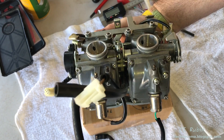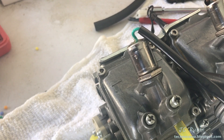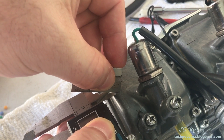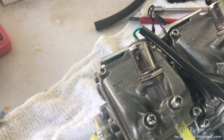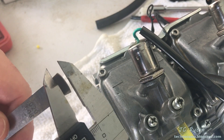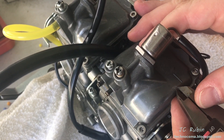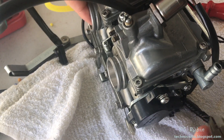We have a good seal — we can continue. To make this job easier, I'm going to pre-mark the areas on this carburetor. We know the line will have to sit between 7.5 and 8.5 millimeters. I'm going to mark those two points — you can see I already have a mark from previously; this is eight millimeters right here, the middle point. It's just a very light scratch with a razor blade. While I have eight millimeters set up I'll do it on the other carb too. I've appropriated a feeler gauge at 0.5 millimeters for this purpose — lock that down at 0.5 and scribe that in. Do the same on the other side. Verifying my work, we're looking about one millimeter off by eight on both sides.